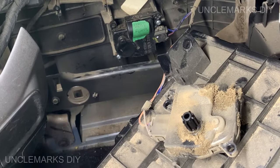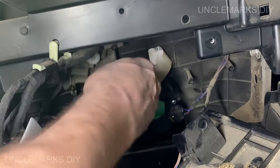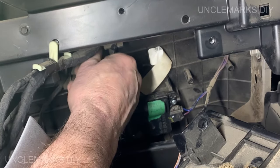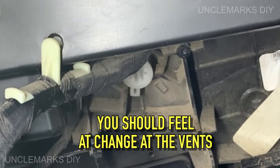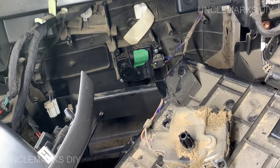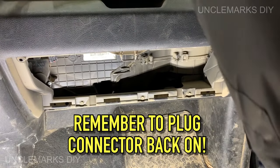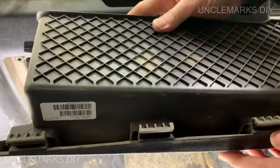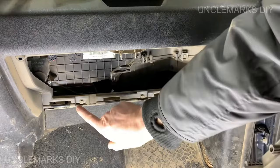Turn the fan on so you can feel the heat — that little motor's working too. That's one way you can see if the motors work: if you can't physically hear them or feel them with your fingers, you can open and close the door. If the fan's running with the truck running, you'll be able to feel it go from hot to cold. The one in the glove box is working — I never did take that one out because I saw it was working. If the motor doesn't work, you can manually move things around and hook the connector back up.